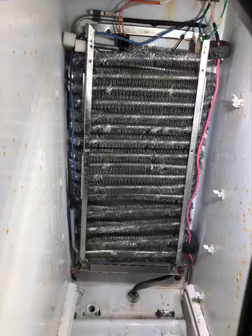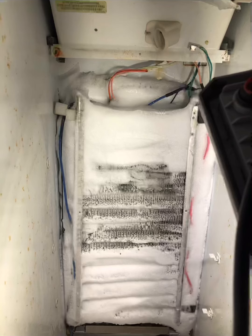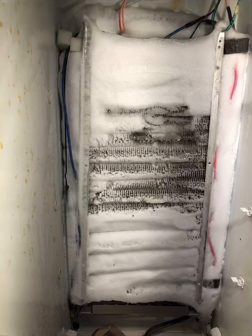A lack of refrigerant, or the compressor not being powered on, or a start device, a timer, or a board. A defrost issue would be a heater or board; a timer in this case would be a board or thermistors. So check the fan as well. Thanks for watching.